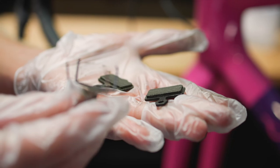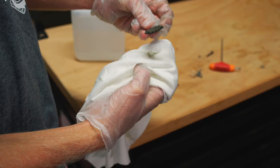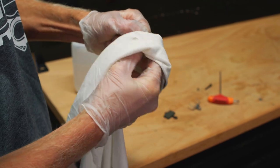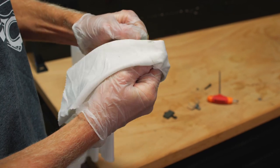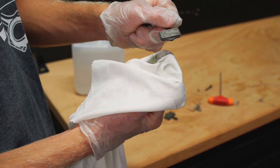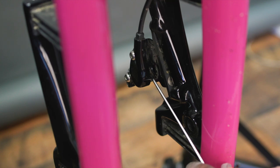You get two pads and a spring that should have all four legs without them being bent. Once again we're using a clean rag and isopropanol alcohol to clean up the pads. If you've contaminated them with either mineral oil for Shimano or Campagnolo, or DOT fluid for SRAM setup, you'll want to use sandpaper — that's the only way to remove it, and even then you're better off just getting a new set of pads. Whilst we've got the stuff out, we're also going to give the pistons a bit of a clean.